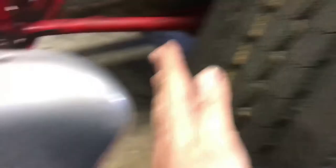The first measurement we're going to take is for toe. Toe is essentially — if my hand is our tire — how far it's going outwards towards the road would be toe out, going inwards would be toe in. The way I take that measurement is this tread mark marks the center of my tire, and I measure it on both sides from the floor up with a tape measure.